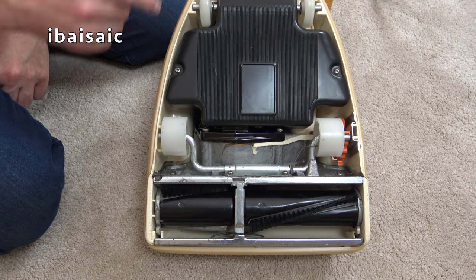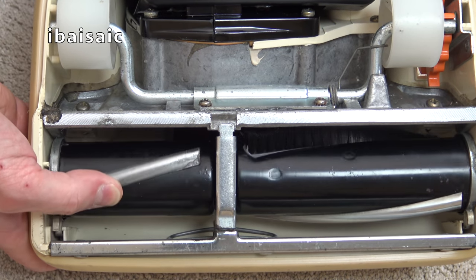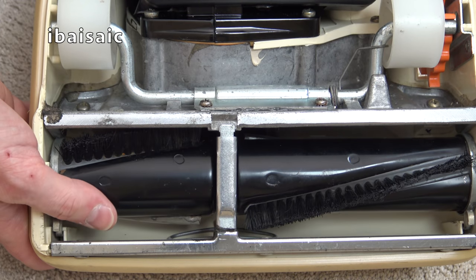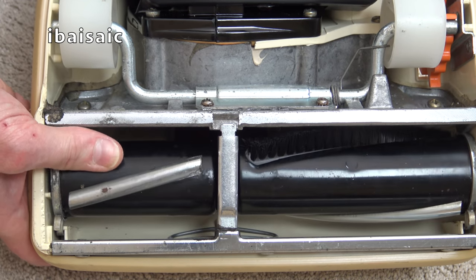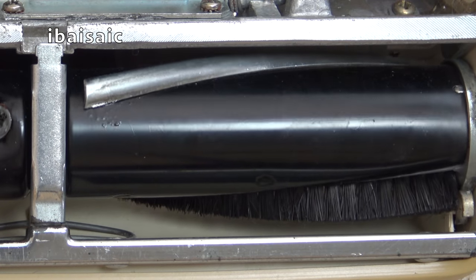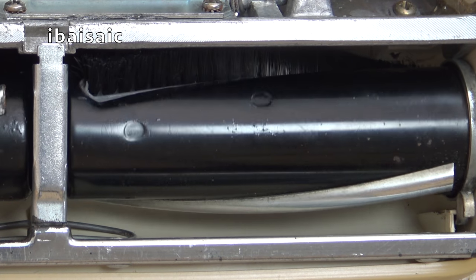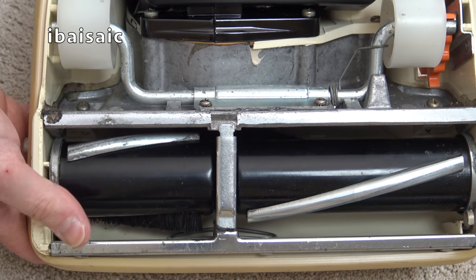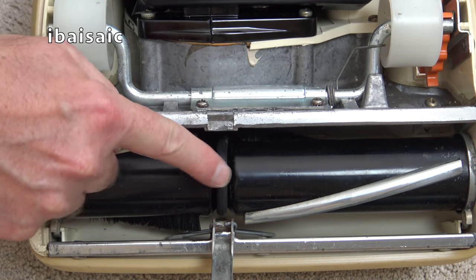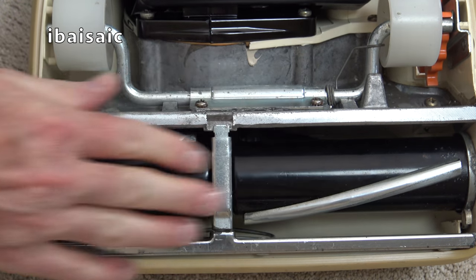Absolutely fantastic condition. Moving down to the Hoover beats as it sweeps, as it cleans, agitator. Now these are painted and often they're rusty and pit marked. This isn't perfect, but it's in pretty good condition. Look at that. You've got the metal beater bars and the brushes, very long, as one would expect. Even as I'm turning this, the belt feels pretty tight, so I don't think I'm even going to have to put a new belt in. Not yet, anyway. The belt's located under there. I'll show you the front of the belt, or the fan assembly, in a minute when I turn the machine back over. But I can't complain with this.